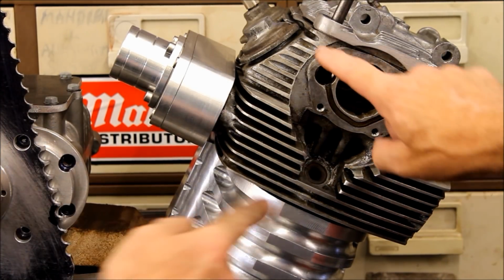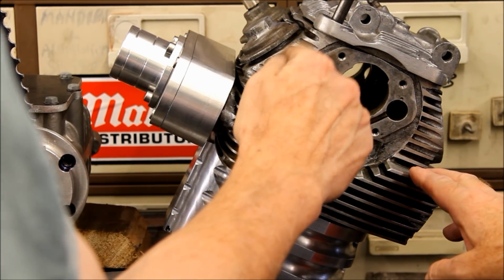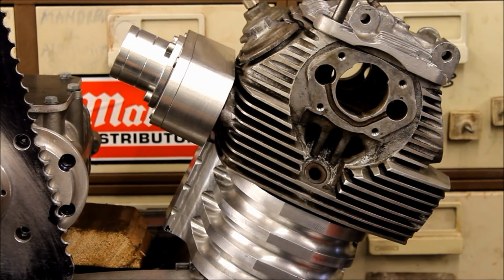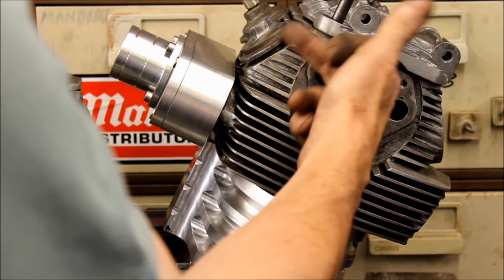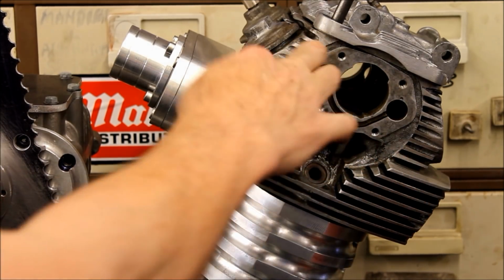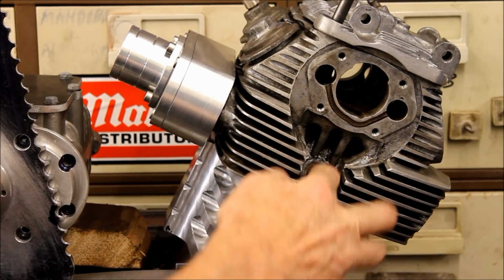Right. And also, of course, you're saying that these things here were damaged on the 250, most of them on the back row. And of course, to repair... Oh, it's not worth it. There's that many heads available. So I've cut them on each side, I've feathered them off. And there's a lot of Hondas actually that just had the fins up to. It's a drag bike. It ain't going to overheat on the drag strip, is it? And I've sort of polished the edges of them and made them look pretty.